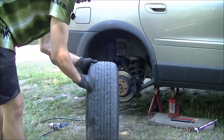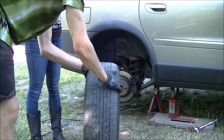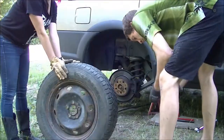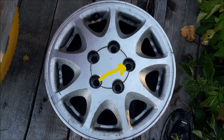This one actually looks like it's still worn, but it's worn very evenly — this side a tiny bit more. When retightening the wheels you have to do so in the correct order — the next bolt you tighten must be across the center from the one you just finished. As you do so you'll notice you're forming a star pattern; the number of points is determined by the number of bolts or nuts on the wheel.